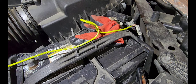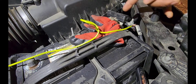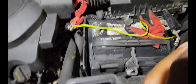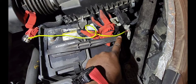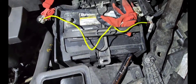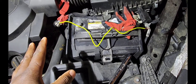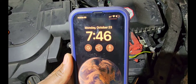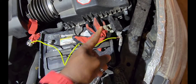So when you reconnect your battery everything will go back to normal. If you're not in a hurry, I'd say leave it for 45 minutes to an hour. You can see my battery cables are pretty dirty — I'll try to clean or replace them. It's connecting positive to negative with just one wire. It would be even easier with a jumper cable — just clamp both ends — which is what I used in my previous video. That's my technique for resetting the ECU. I'm going to leave it here, it's 7:45, October 23rd.